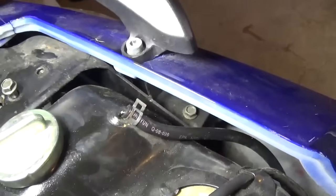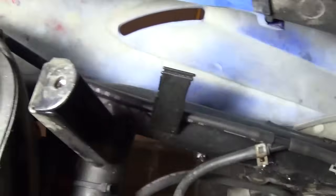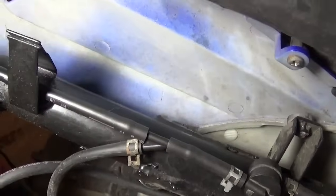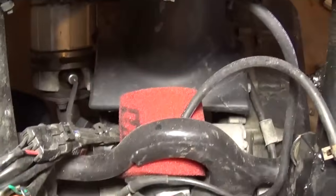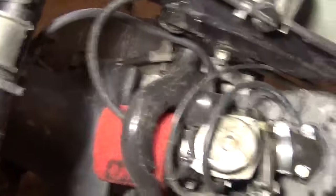For the evaporative emissions, there's a vent on top of the fuel tank that goes down over here to a little T, and also goes back into the air filter. This valve prevents fuel vapors from going from the tank back into the crankcase — crankcase out to the intake, fuel also into the intake.